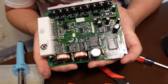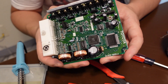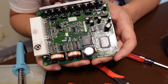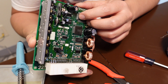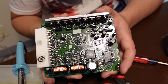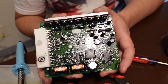The interesting thing was the replacements I got on Yahoo Auctions were the right microfarad but the wrong voltages. A lot of them were looking for 15 or 16 volts, and these were rated for 35 volts — so it's like double the voltage necessary. I don't know much about capacitors, but so far it seems to be okay. We'll follow up if things break, but I'm just going to shove this back in the car, and I think that's the end of it.